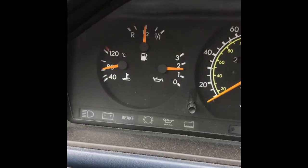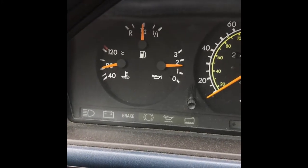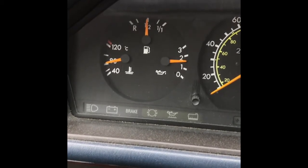You can see the car is running at a consistent 80 degrees. For the last few months it's been running more around the 50 degree range, so it appears that it's doing the job. The reason I took on this job was because the car was coughing and smoking, and it would take about a minute of sputtering with a lot of white smoke coming out the back. Then it would clear and take off and drive normally. Doing some troubleshooting, I realized it was running too cold.